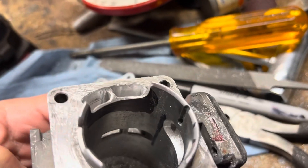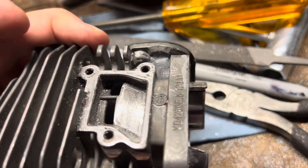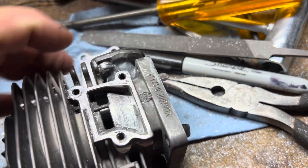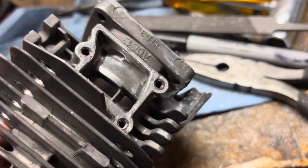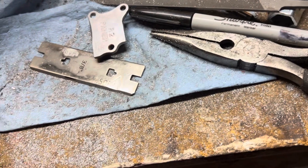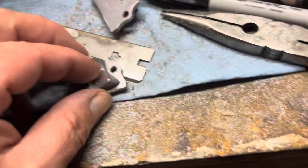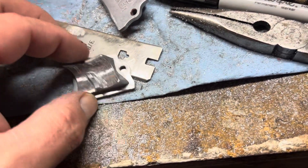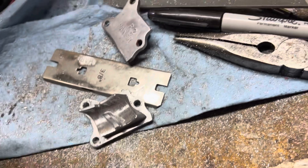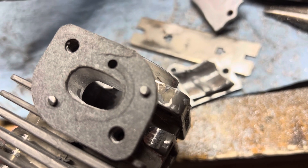That's so close it's embarrassingly ugly. That's your insides — I just let a diamond bit skeet over it. It gives it a nice rough finish but doesn't really change the texture too much. I like that better than just a mill finish personally. Did the same thing with these — just hit them with a burr at a real low speed, it just roughs it up. Same thing I did with the intake here. Using sandpaper just got a little ugly for me.